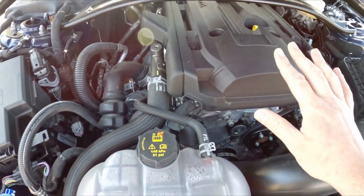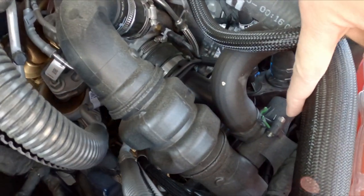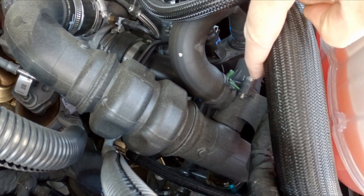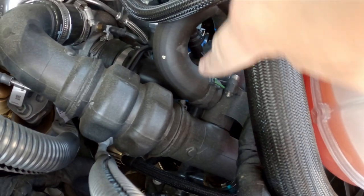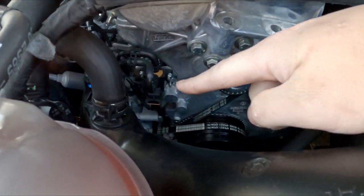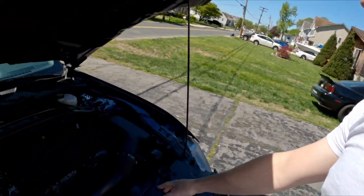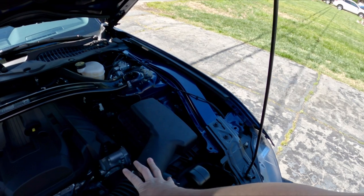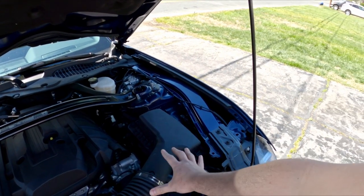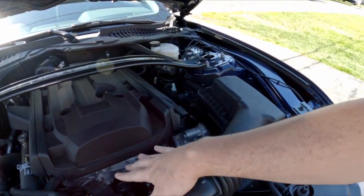From the factory, all EcoBoost engines have the blow-off valve right down in here - it's electronically actuated. From there you have a hose that vents all the extra pressure back into the intake pipe to the turbo. Because of that, the only way you really ever hear any blow-off noise is if you change out your intake for an aftermarket open filter intake, where it doesn't muffle the sound when air gets discharged back into the pipe.